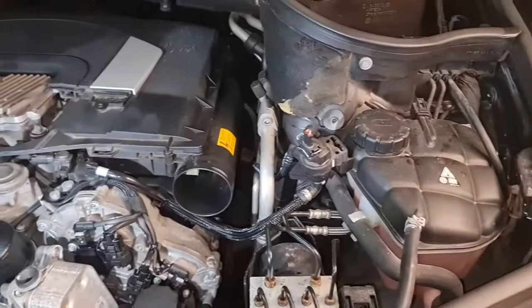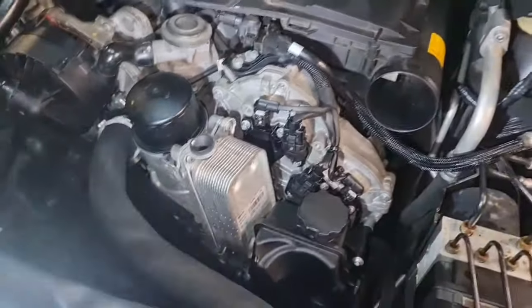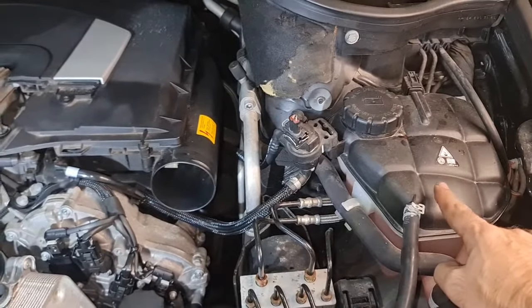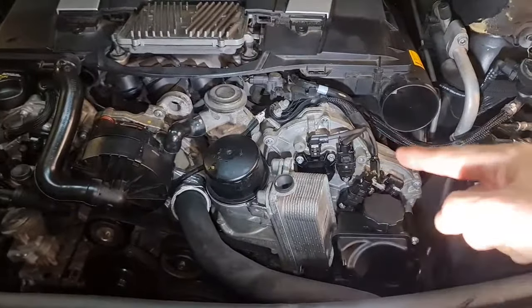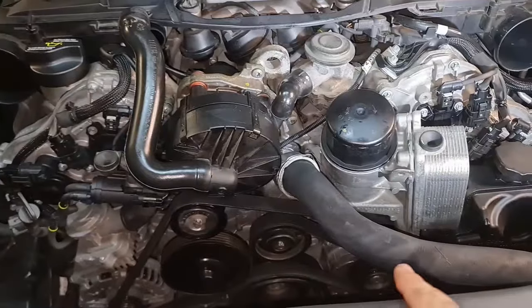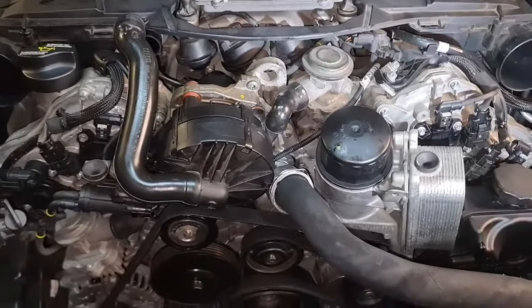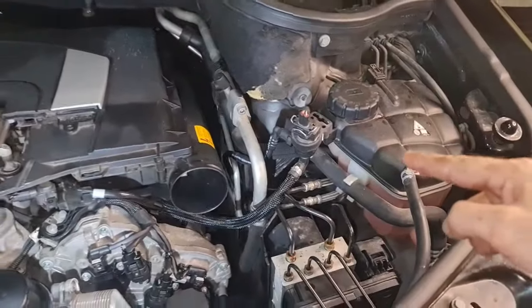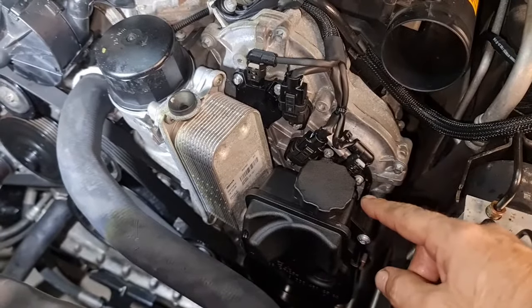Okay, finally, after a week of working almost 2 hours a day, this is almost done. We topped up the coolant. We will check it later when the thermostat opens. The oil is in and checked. We will check it again. The gasket is done. All the gaskets, including the idlers and pulleys, checked. The belt is checked. The oil filter changed, oil changed, and the coolant renewed. We also topped up the steering fluid.